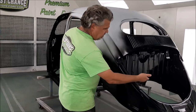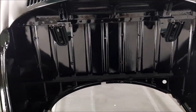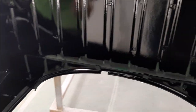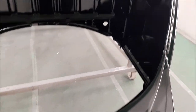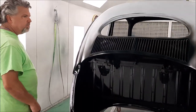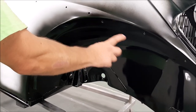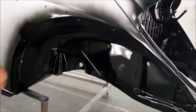You'll notice at the back we have the whole engine bay. All the detailed work has been done. The engine bay has all been primed and painted and you can see it's all nice and smooth. They like to do all of the edges and then feather and sand, then do the masking so there won't be any masking lines. Coming into the wheel wells, we've done the whole underside of the body. You can see the whole inside wheel well — it looks brand new with that extensive metalwork done to it.